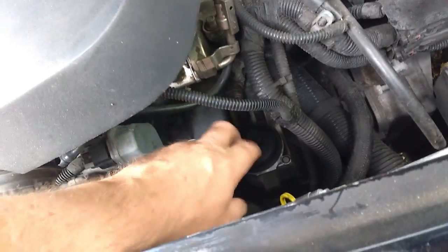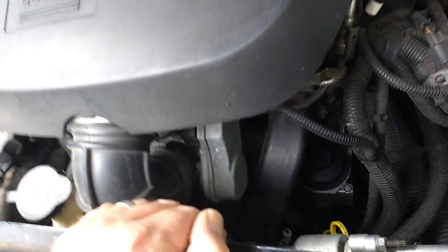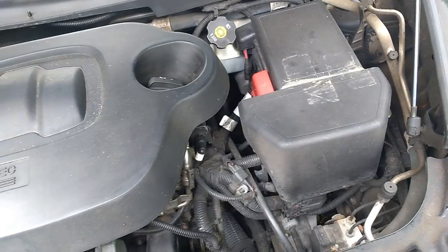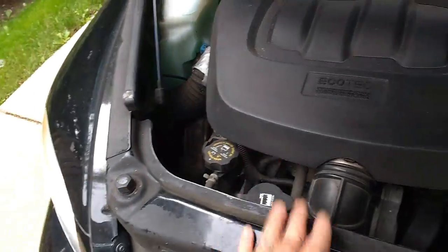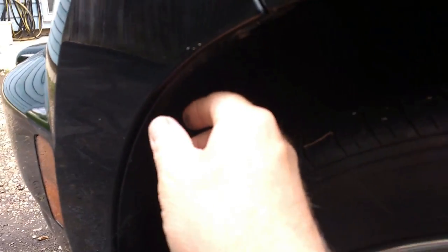I think these intakes are plastic — they've got a plastic coating, I'm not really sure which. That is not the battery, although it does have two battery posts on it for jump-starting. The battery's in the back, I'll show you that. And for all the room there is in here, you think you can get to the headlights — no, you can't. This was one of the dumbest moves I've ever seen Chevy do. In order to replace your headlights, you have to take the inner fender well out. What I do is remove all the fasteners to about the center of the wheel, pull it back, and then I can get to the headlights and driving lights. Not exactly an ideal situation.